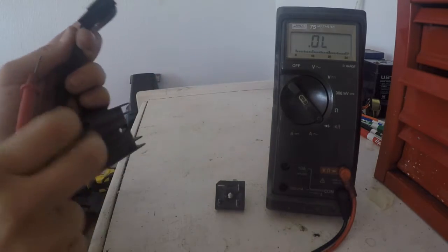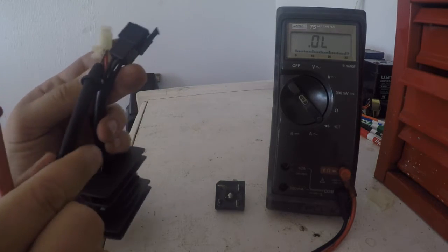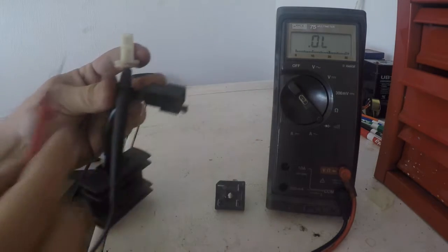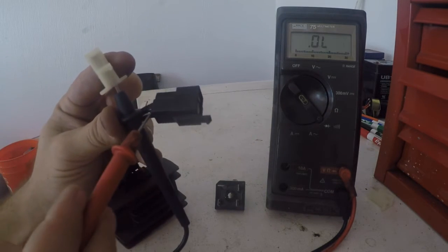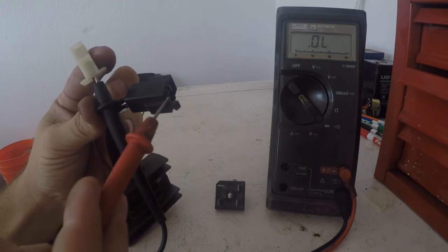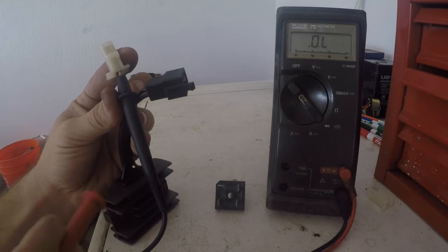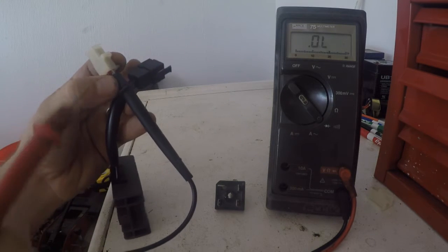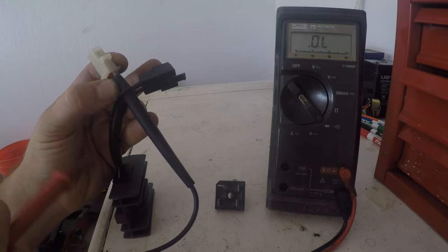And I know that in the video I was saying from your yellow wires from your stator, but your yellow wires from your stator are actually going to plug into the 3 black wires here for your plug. So your yellow wires from your stator will be over here, they connect here, black wires will come down, feed into here, and go back out. So like I said, we're going to check the diodes inside of here, and this is a brand new one, so you're going to see what we get readings on.